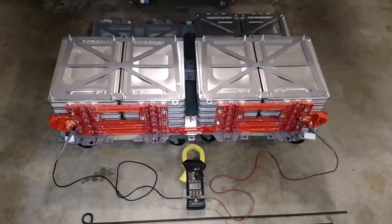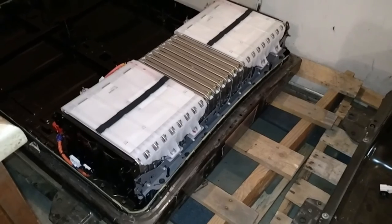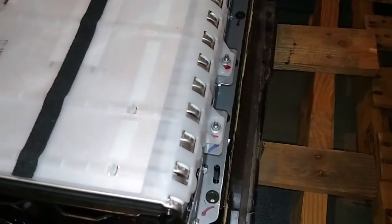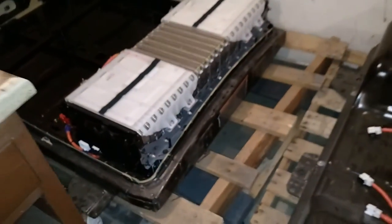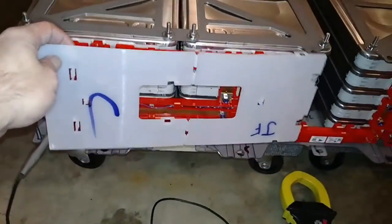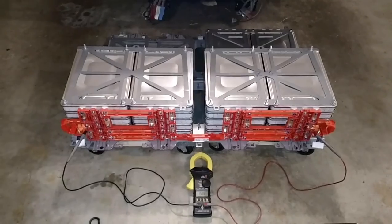The front battery boxes are going to need a little more engineering because this stack is about 13 and a half inches wide and I only have 13 inches of room. But a lot of it is the heat pads sticking out, so I think I can shave off a quarter inch on each side, recover that half inch, and get it in there — not too worried about that. I do have all the safety covers, which should just pop right back on. Thanks for watching!